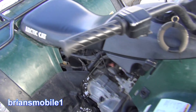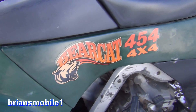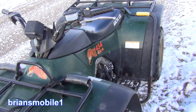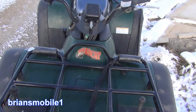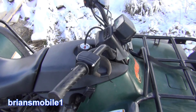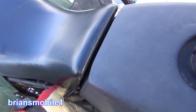This fine specimen is an Arctic Cat Bearcat, the 454 4-wheel drive. This thing is amazing and capable but it's always stumbled. I've been through the carburetor, I've been through the fuel tank, I replaced the gas cap, breather vent valve. It just feels like the air filter's clogged because it just can't get up to a certain RPM.